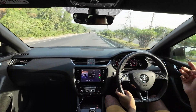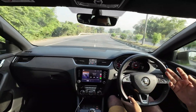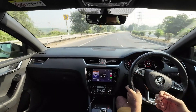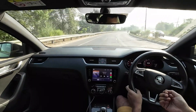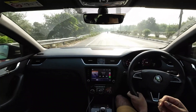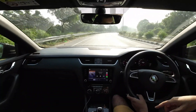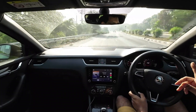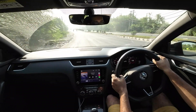So if you have one of these cars — manual, DSG, 1 litre, 1.5 litre — you can actually check behind your brake drum to see if there is what looks like a caliper mounting bracket. If it's there, very good — you can go and order the rear brake discs, calipers, and brake pads from the Polo GTI and put them on. If there isn't, then you're out of luck, because the entire twist beam suspension needs to be changed. I believe it comes as a one-piece unit, so you can't just change the hub and get the carriers.